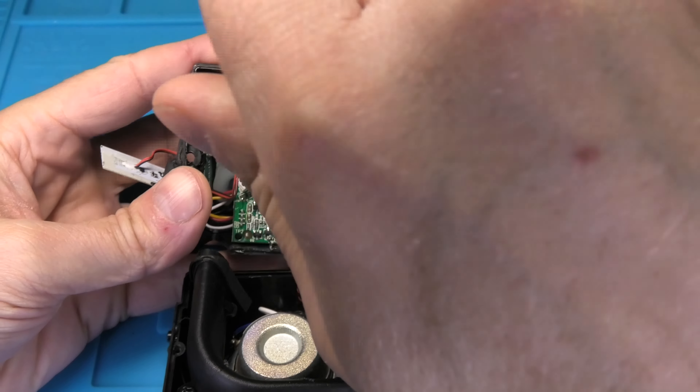When we bend this open, you can see the old battery. Luckily, the wires to the battery are not soldered onto the motherboard — there is actually a connector — so we can easily unplug the old connector and take out the battery. The battery is held in position by more of that black goop, so we can relatively easily take it out. We can immediately see that something is wrong because the battery has become very puffy, which is not normal and usually indicates the battery is bad and needs to be replaced.